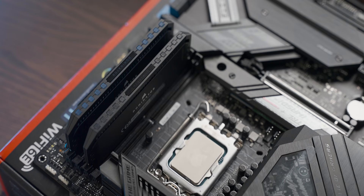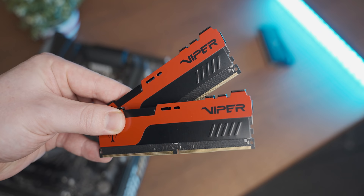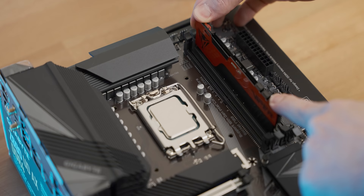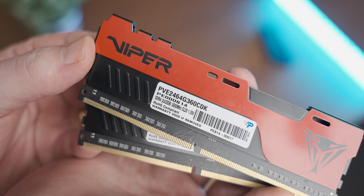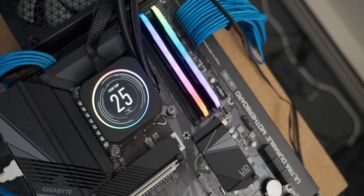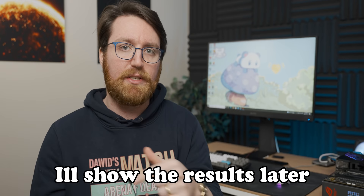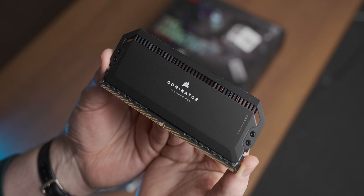Moving over to the RAM kits — which is the important part, essentially what we're testing — there is a little bit of a discrepancy in capacity between the DDR4 and DDR5 kits. My 64GB DDR4 kit completely refused to work with that Gigabyte board; the only speed I could get to boot was 2666 MHz. So I ended up using a Corsair Vengeance RGB Pro SL kit that worked straight out of the box, which is a 16GB kit that can run up to DDR4-3600 MHz, as opposed to the 64GB DDR5 kit. I did test 16 vs 64GB with DDR4 at 2666 MHz, and the 16GB kit was actually a bit faster, so the capacity difference shouldn't affect the tests too much — but just bear that in mind.